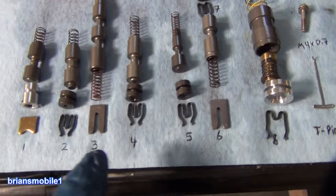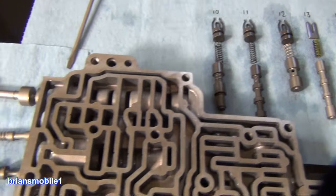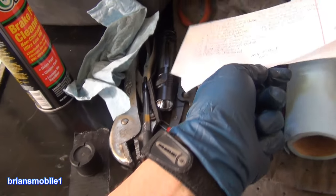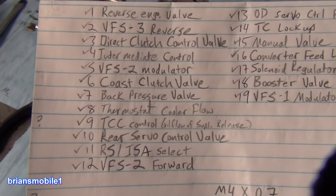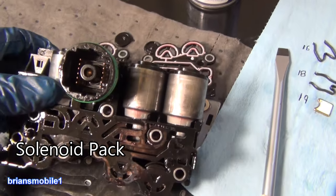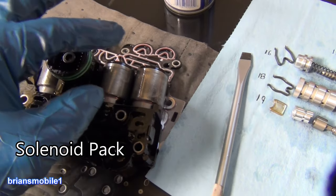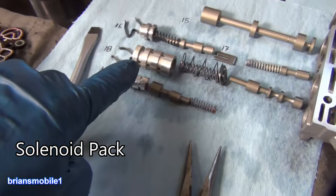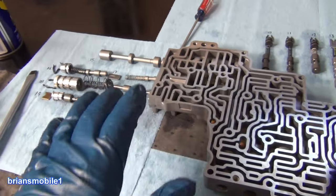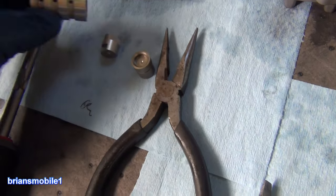As far as the numbering of what these are and what they do, I'll try to type that out for you in the show more — if you're willing to click like, I'm willing to do that for you. Or if you can read my handwriting, this is what they are. These work a lot like a fuel injector — they work based on pulse width and kind of shutter. That can create the desired pressure right here on your boost valve to give the right pressure to the right place. Inside the boost valve you've got that guy and this guy.